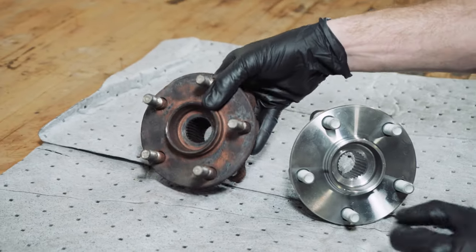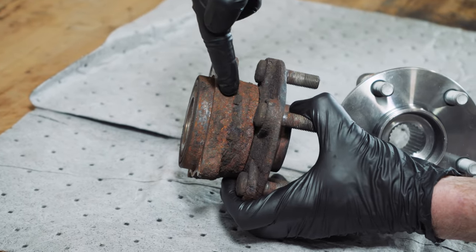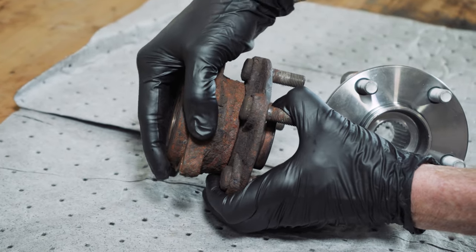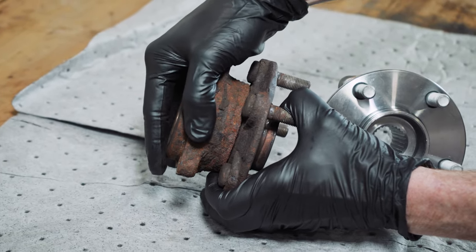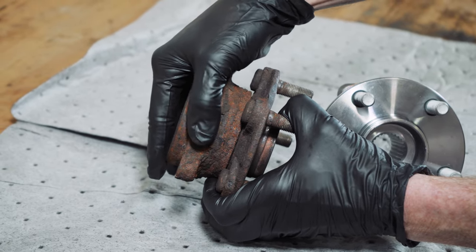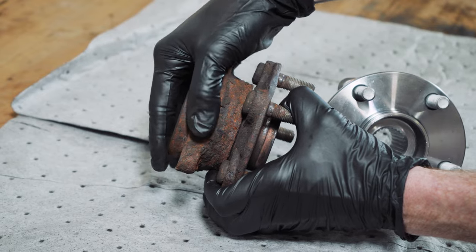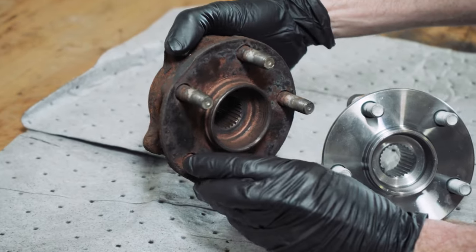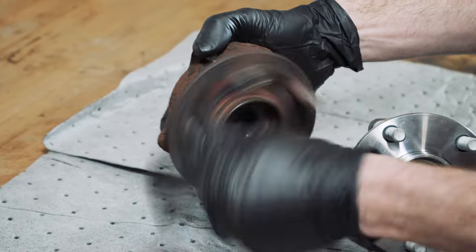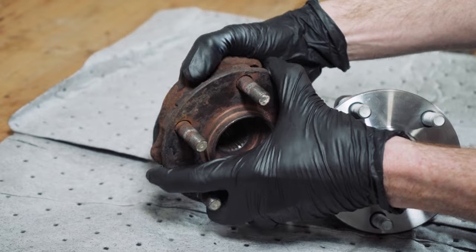Now that we have the bearing out of the vehicle, we can have a closer look at it. As I turn this, what I want you to pay attention to is in between this area and the hub of the bearing — pretty much right inside this crack. I'll give this a light wiggle. I can see a whole bunch of movement coming from that area — that's not good. I can't apply nearly as much pressure as having the weight of the vehicle on the ground would cause on this bearing. Let's give this a quick spin. As you can tell, this spins with no resistance. That means the grease on the inside has worked its way out and the bearing has failed. You can even hear some noise.